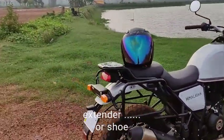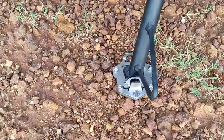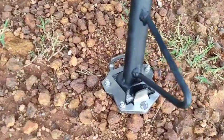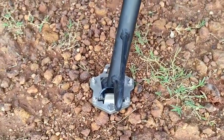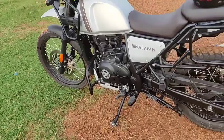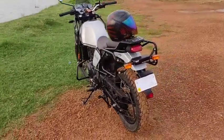You can Google it, buy it online, or get it from the local accessory shop. The fitting of the sidestand extender can be a bit challenging — you might need a small hammer, especially for the top section. But once it's fitted, it's a nice sturdy piece of metal, a must for all Himalayan riders. Because of the small base, if the soil is not hard enough, the sidestand will sink and the bike may fall.